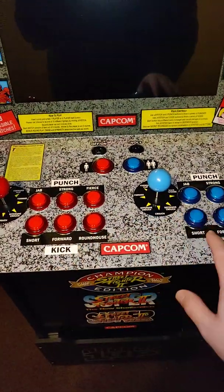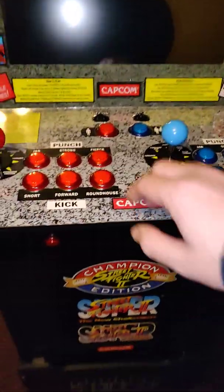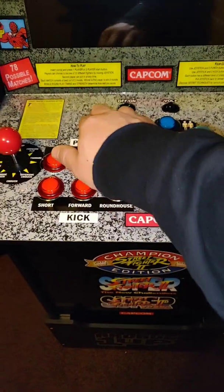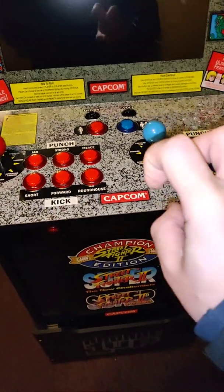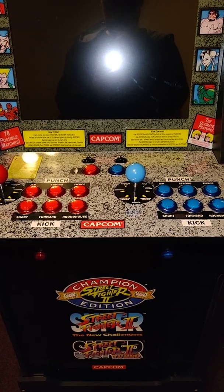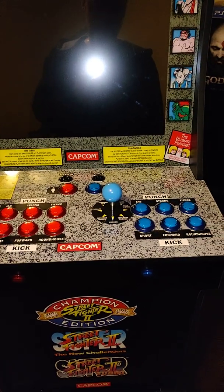I chose the red and blue buttons like ETA Prime's video originally suggested, and I went ahead and added two extra buttons right here. Not on top, because I have the plexiglass cover that Arcade1Up sent me for protection on the board — I didn't want to drill holes there. Just trying to keep this as stock as possible. I added these two buttons and just ran wires from inside to here. I drilled the holes with a step bit drill that I have the link for in the description.